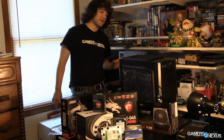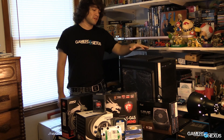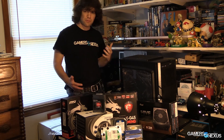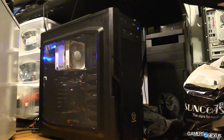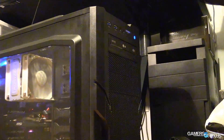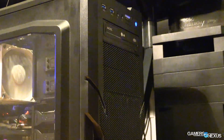The case has a 120mm fan in the back and 120mm in the front. You can easily drop more fans in the top and bottom if you want more cooling. For our purposes, it'll be fine with that CPU cooler unless your room runs pretty hot or you're overclocking your GPU as well. It has a little bit of cable management room in the back — pretty straightforward stuff.